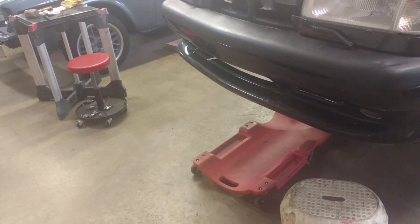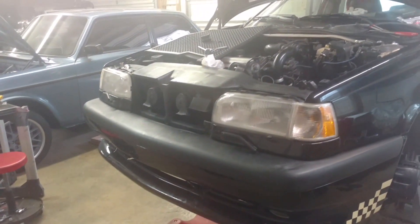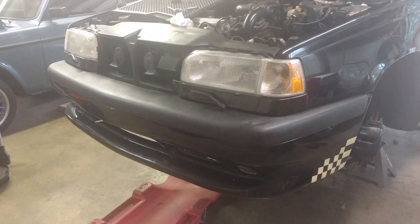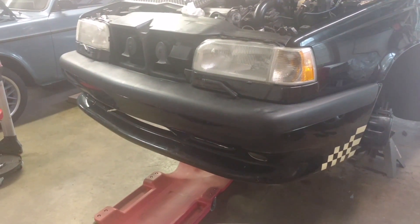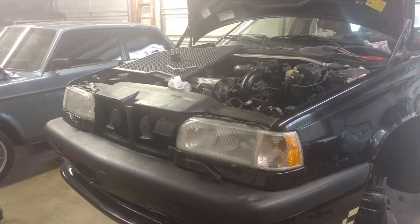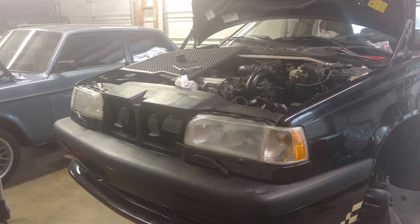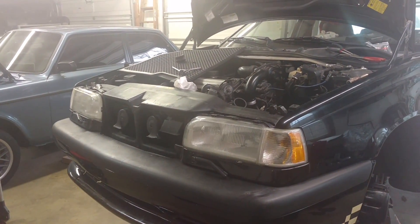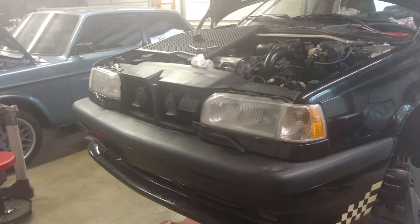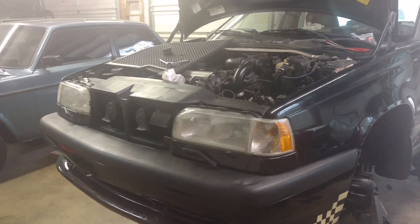Something like I did when I did the rear main seal — set it on some bricks. You can separate it and put it back together like that. If you choose to lower the subframe of the car, you really need to set the whole thing on the ground. We left the engine braced up in the car and just tilted it down, and that was very difficult to pull off. So you're better off setting it on the ground or pulling both units out the top. Other than that, you're really going to have some struggles.